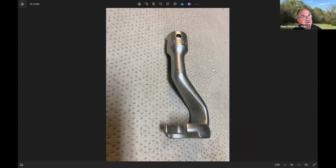Yeah, I've never seen anybody talk about doing that on a mileage basis. I've always seen it time, and I'm thinking maybe 10 years. I'll show you here in a minute that the guide that I got to put in this engine was not as good as the original guide in that it was plastic and the original guide had metal on it. So I think the replacement guides probably have a shorter life than the Mercedes original guides too.